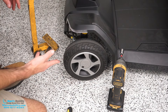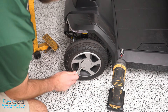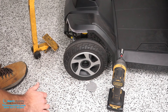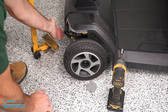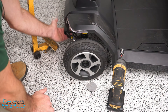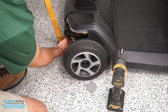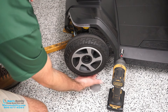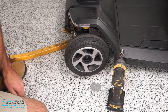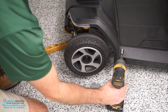I'm going to start with the front tire here. I'm going to grab my flathead screwdriver and pop this little cap off, and that exposes the bolt in here. Next, I'm going to take my hand jack. If you don't have one of these, you can throw some wood under here, pretty much anything to prop up the scooter. That would just rest it on the frame. I'll use these hand jacks and lift this up just enough so that the tire free spins and I can pull it off once I take the bolt out. This is a half inch bolt. You could use 13 millimeter if you don't have a half inch.